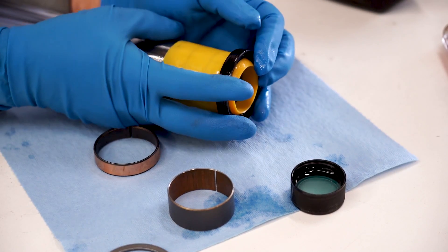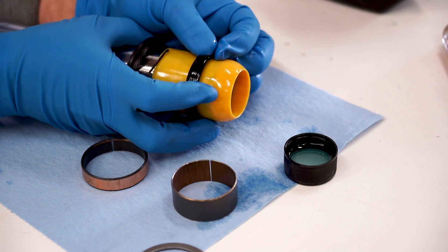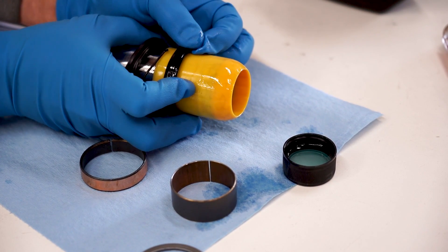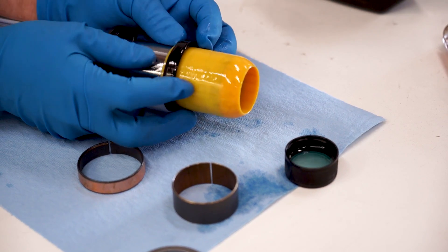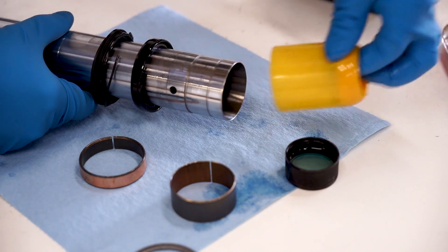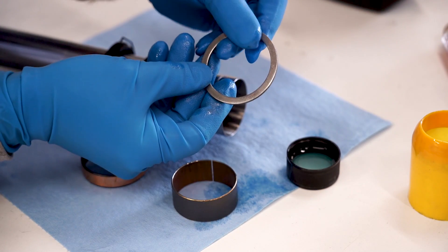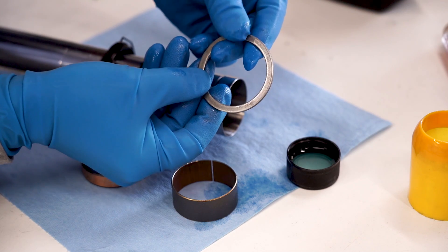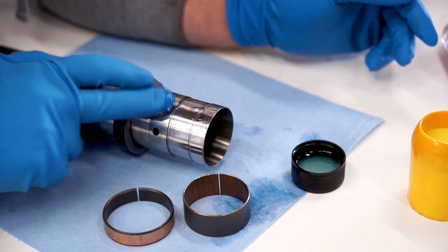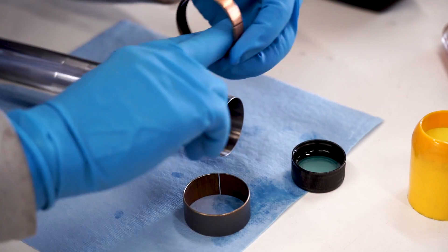She's a little tight - probably should have got the right size bullet, but I think that'll work just fine. Now the bullet can come off. Then we've got the backup washer - this is going to go with the rounded edge facing down. And then all we got left are these two bushings. The smaller bushing is going to go on first, and then this one's going to snap into this groove here. You might have to expand it slightly as it goes on.